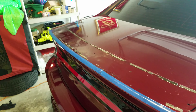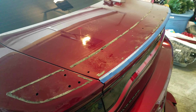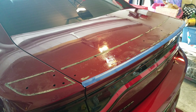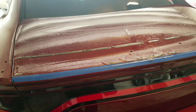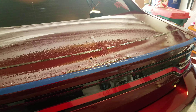I'm back — fishing line, that's how you get this thing off without scratching the paint. And there it is, folks — it came off pretty good! The next step is to clean it up, get all this adhesive off, get it nice and shiny, and once it's shining that's when I'll put the new spoiler on and check the fitment. Stay tuned.